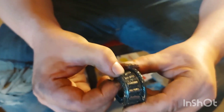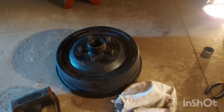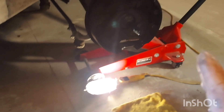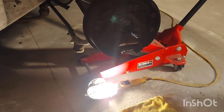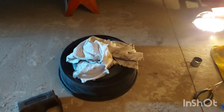We already repacked these bearings. We're going to put the drum off to the side — we already freshened this one up and painted it and it still looks great. Cover it and move it off to the side, because we're working with brake parts and there's going to be a lot of dirt and dust. You don't want it in the bearings, so just cover them up, keep it clean and safe. This one's already repacked.